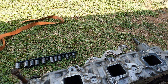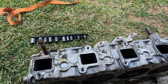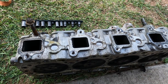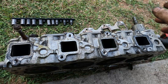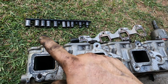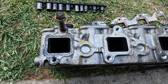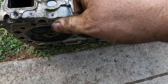Even looking at the gasket didn't see anywhere it was leaking. The dowel pin was stuck in it on this one - I might pull that out before I take it to the machine shop. I did pull it off with the exhaust manifold on and it actually wasn't too bad as far as weight - I lifted it right up no problem. With the head being aluminum that makes a big difference. There'll be six bolts and two studs - one stud came out, one didn't, but we're going to leave that in there to avoid stripping any threads.